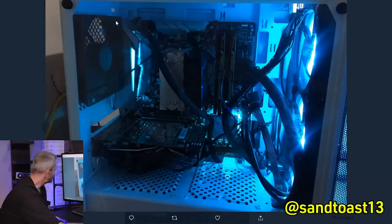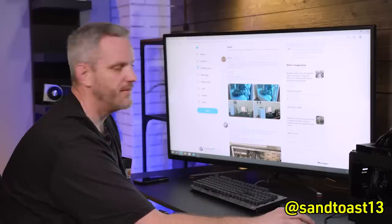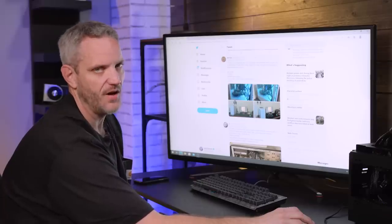I feel like a lot of people never notice that when they build it, but you could totally rotate it. I usually put the fan cable coming out in the top right, closest to the motherboard tray. That way it can just straight shot over into the hole. Or I will sometimes use this IO shield or the VRM cover to hide the cable. And then a lot of motherboards have a plug down here or somewhere for the CPU cooler to plug in, because they're not always all up there. Don't blame it on your case. The case is not the fault here.